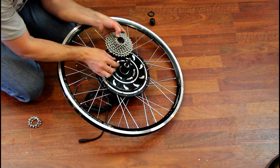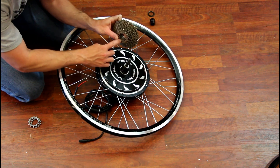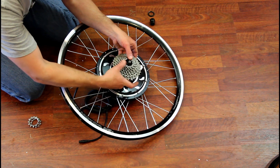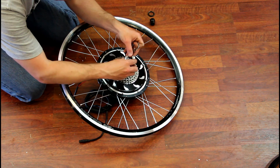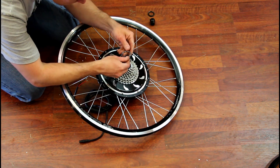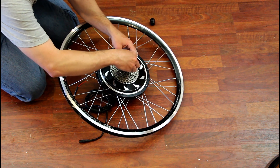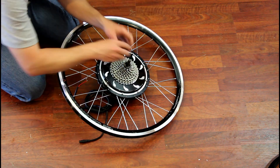Getting the cassette on the new hub can be tricky. Spin it around until you find a section where the teeth are oddly wide. You'll see a section in the gears where the teeth are also fairly wide, and that's going to fit this wide slot. Go ahead and fit that in place, and then follow up with any additional gears you have to put into the system, then secure your cassette just as you removed it.